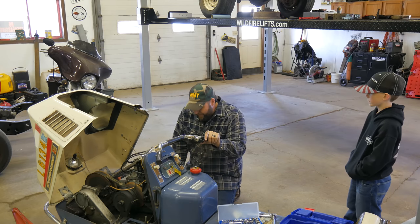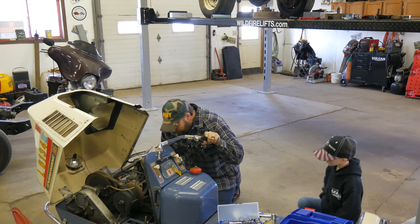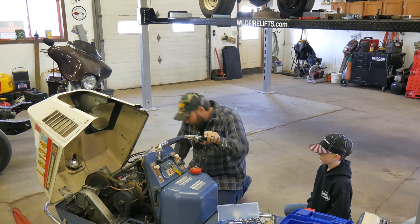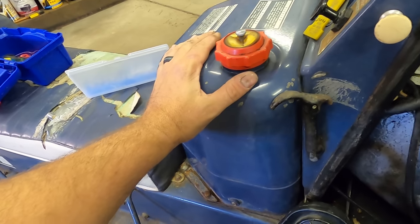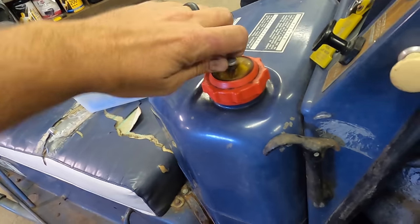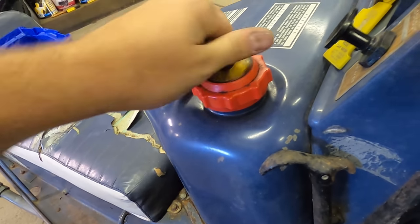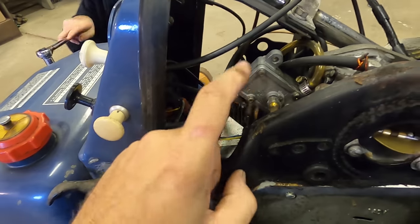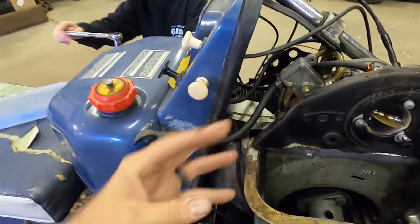The carb is off. Over here I've got three more bolts and then this guy should come out. Always make sure your vents are working on this kind of fuel pump - this one was closed. Always make sure your vents are working when you're running this kind of fuel pump. If it's not venting properly, you're not going to get good fuel suction.